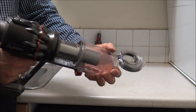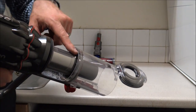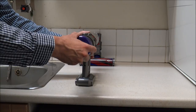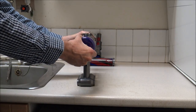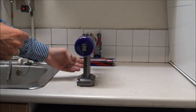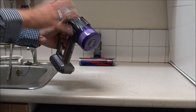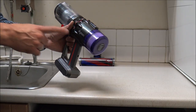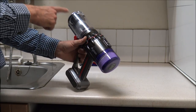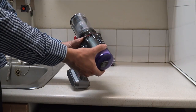As far as the main body of the vacuum cleaner, the bin itself — you'll notice it's nice and shiny again, almost as new. That just clicks back on. You can see the rubber seal around there, and as I mentioned, we've made sure that's nice and clean. The last thing we need to do is pop the filter back on — locate that, twist it, and just make sure it's fully back in the original position. Cleaning the filter is actually an easy thing to do. If you get the pulsing, the first thing is to check there are no blockages within the main body of the vacuum.